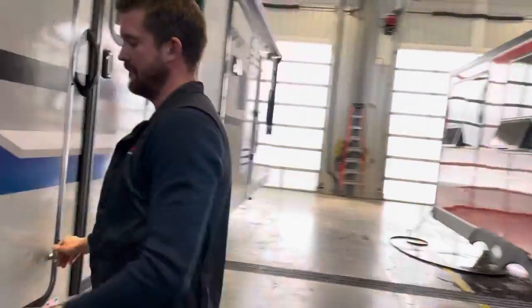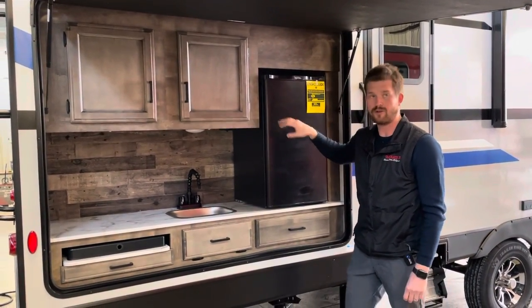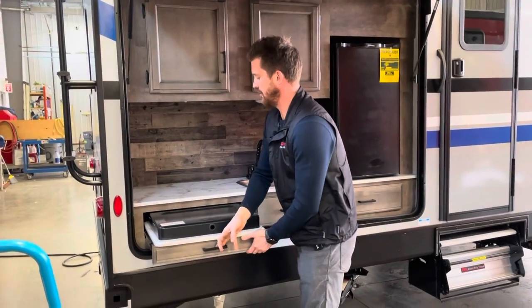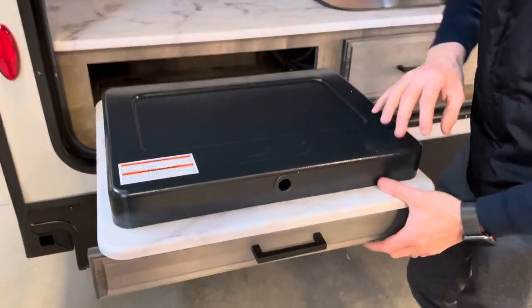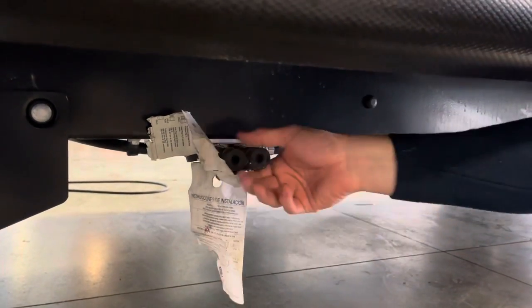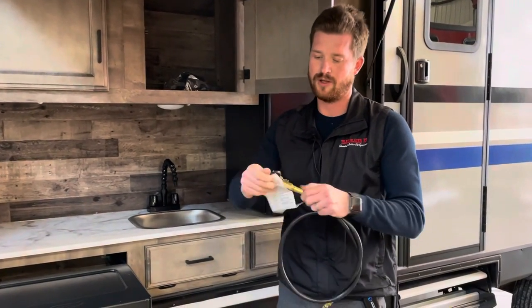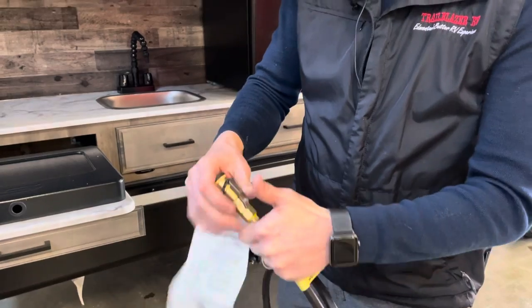Follow me around this side — here you have your outside kitchen. Your fridge runs on electricity only, so unlike your main RV fridge, this doesn't run on propane; you need to be hooked up to power. Your stove top does use propane — it's a simple two-burner stove top that you'll light with a barbecue lighter. You need to hook up the propane line; right underneath the stove you'll find a quick-connect coupler — there are actually two, one for the stove and one for a supplemental appliance. You'll find that quick-connect line here; just connect both quick connects, and note they'll have a valve on them in the closed position — you'll need to open that for any propane to flow.